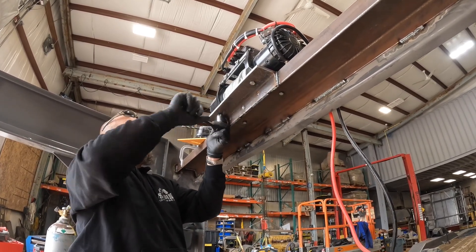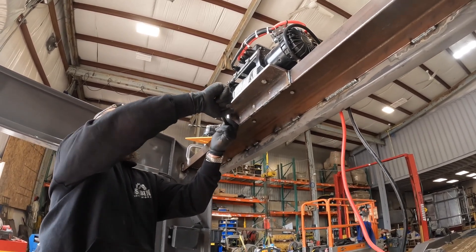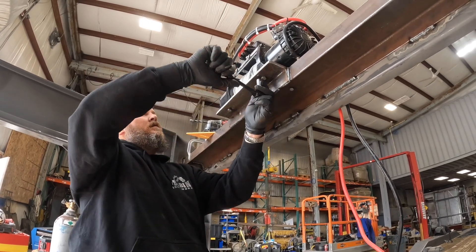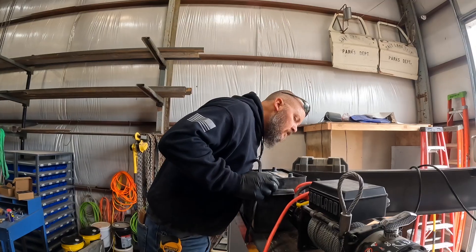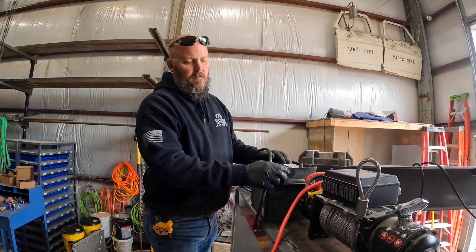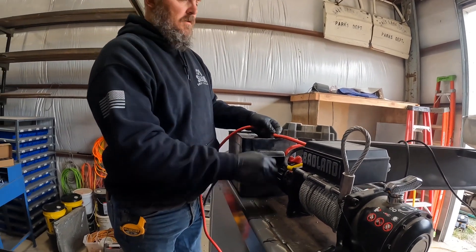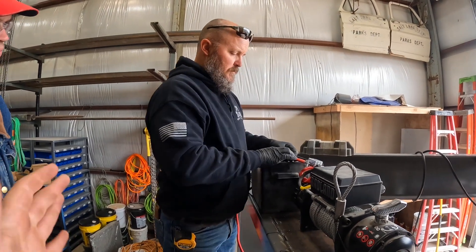It might do to put a little tack weld on each one since they don't have a washer in there — just a tiny tack to hold it in place. Or you could just weld them on fully. I don't want to do that, because I've got to get this off one day to upgrade to a bigger winch. I'd like the 12,000-pounder on this. Well, this thing's actually already grounded to it, so now all we've got to do is get this connected. We'll do one to the structure and then route this in here and clean that up.